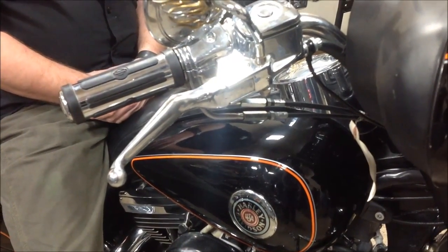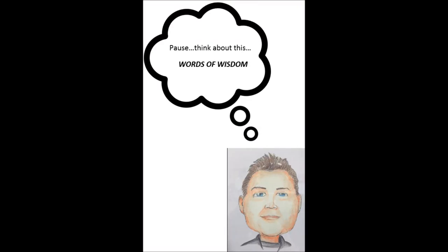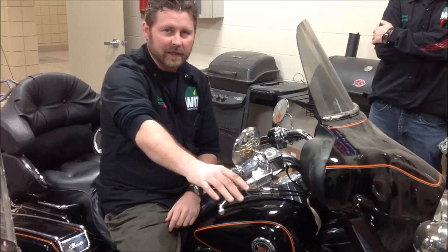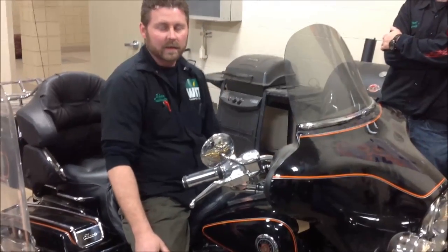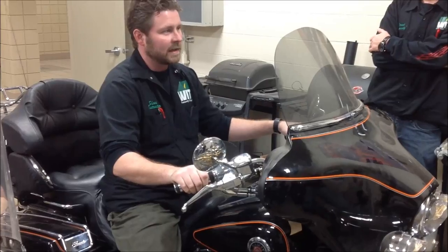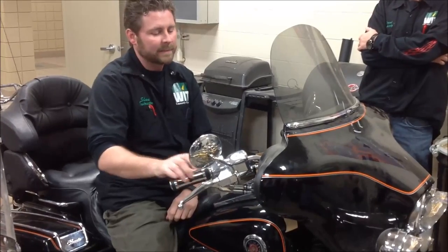What do I know? It's almost guaranteed that the routing or the hookup on the carburetor itself — or throttle body if it's fuel injected — something's wrong. Could it simply be that the cables need to be lubricated and serviced? Either way, this is our responsibility. This isn't something we can overlook, and it is dangerous. You've got to remember, this could be your wife, husband, kids, uncle, or best friend riding this bike. When that car pulls out in front of them and they go to chop the throttle and the engine is hanging up at cruising RPM, that is absolutely a problem. This is dangerous.